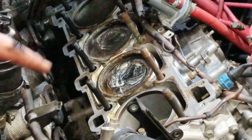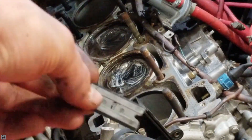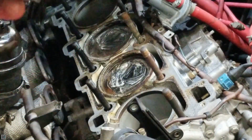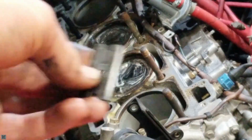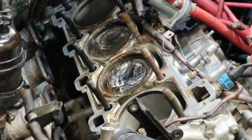10 to 15 minutes later, you're going to use your plastic scraper. You want to make sure it's plastic because plastic can't scratch metal, so the plastic one won't damage your piston heads. Let that cook on there, then come back and scrape off all the stuff while it's still soaked in and easy to get off, then take your microfiber and wipe it off.